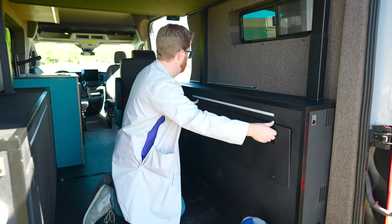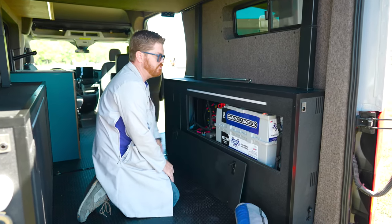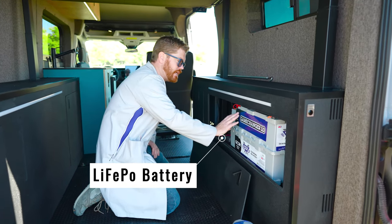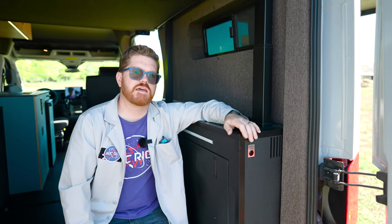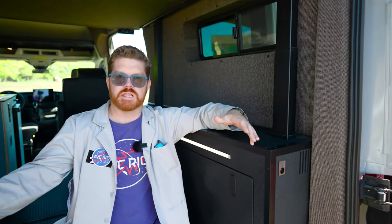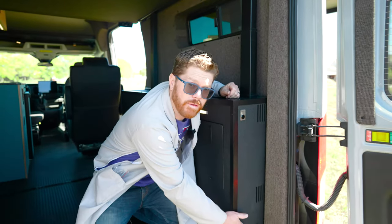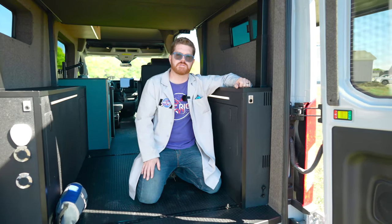On the opposite side of the van we have our electrical system using the Battleborn Game Changer 3.0 battery — a 270 amp-hour lithium-ion battery with the heated option, important here in Colorado. On the passenger side behind our primary door we have our cargo light switch — we put it behind the first door we open so we can light up the cargo area immediately to find our gear. Below that is a 12-volt outlet for pumping up a paddle board or powering a transfer pump.